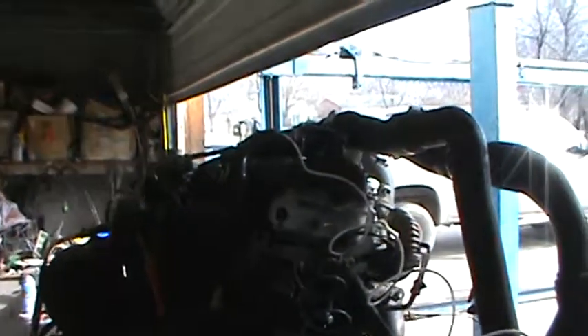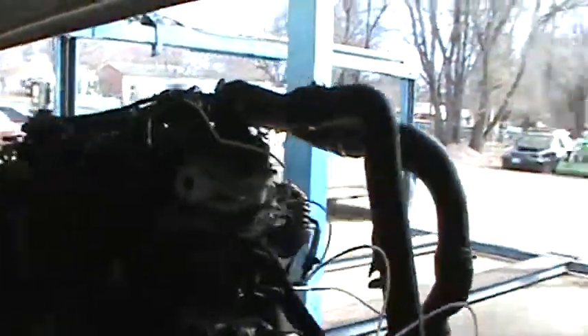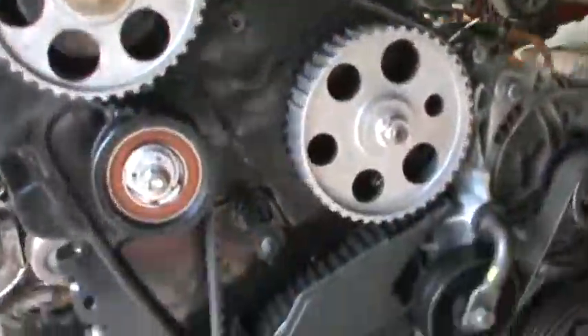You can see that the EGT didn't go over 1050, oil pressure is good, 160 foot-pounds of torque, 2000 RPM, idles right around about 900, which is typical for the MTDIs.